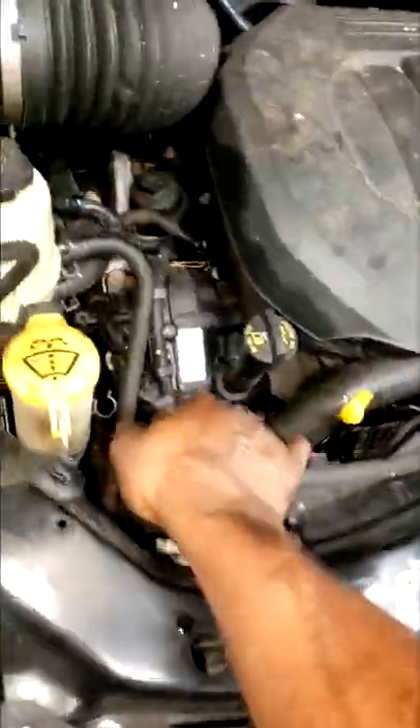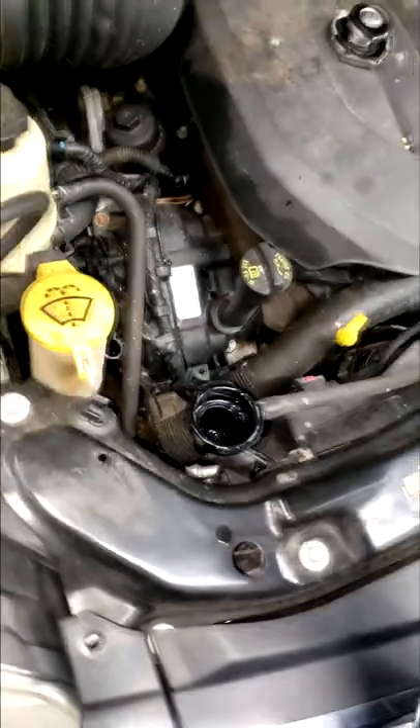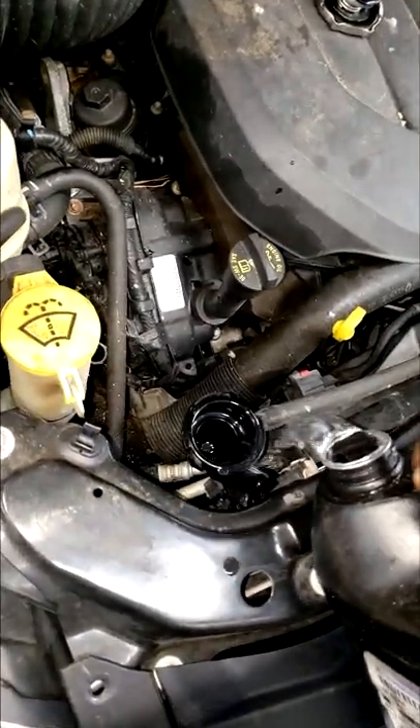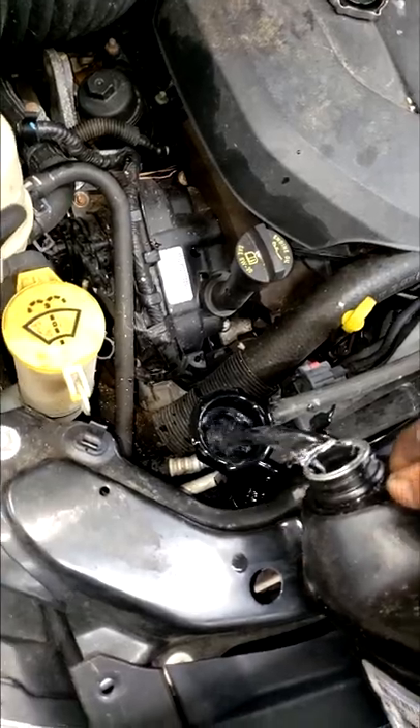Hey, it's Ted. Short guys, Caravan overheating. First thing I'm gonna do is make sure this thing got some cooling in it. Actually, if you're diagnosing it, it doesn't have to be coolant — it can be water. So what I'm gonna do is add some water, we gonna pressurize the system, and then check for the leak.